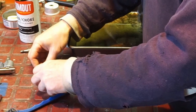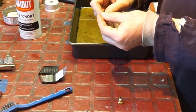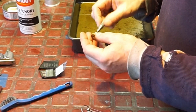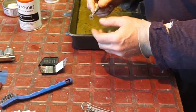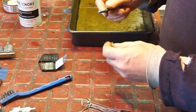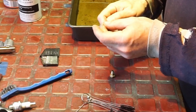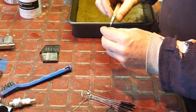Here at sea level these are generally set up for CARB/EPA compliant California restrictions, and then the motors get older. I'm at sea level so we're going to have the maximum amount of air pressure — they tend to run lean, especially with a little oxidation. So I just took this out to 26 thousandths and that's probably where it was because I didn't really feel it cut anything — it's just whatever gook was in there. We'll go one more. This is 28. Yeah, 28 — that one is actually cutting a little bit.